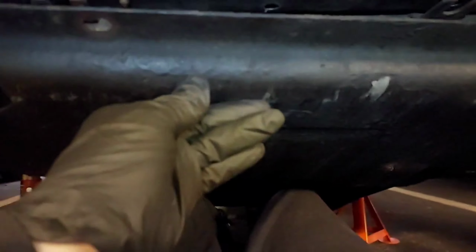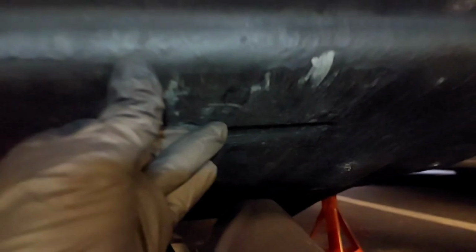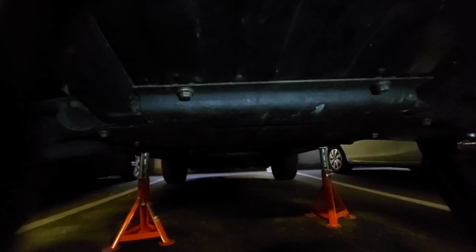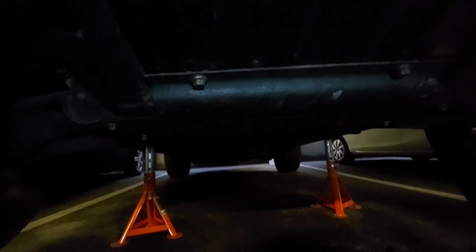Then you're going to put on the first 2 front nuts onto it there, and once they're in, just use your fingers first to put in for the first few turns, and then lift up and follow through with the rest on either side and work your way down. That's the technique that I use. So the crash plate is back on, and all the nuts are tightened to 25 Newton meters, just the same as the oil sump. And that's basically it.